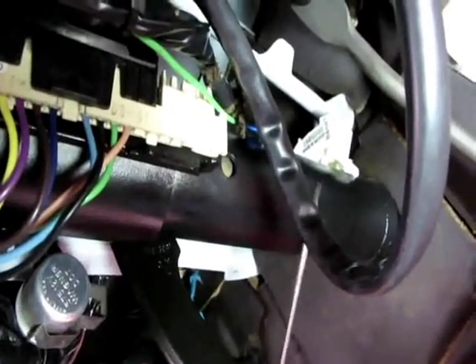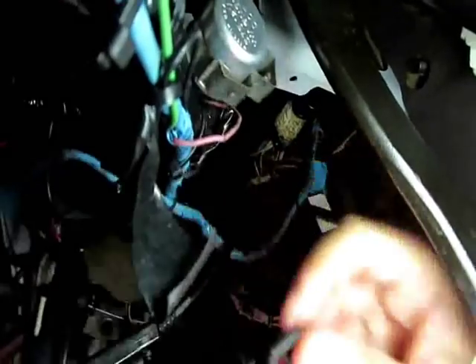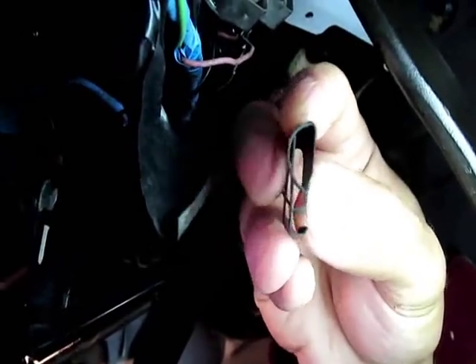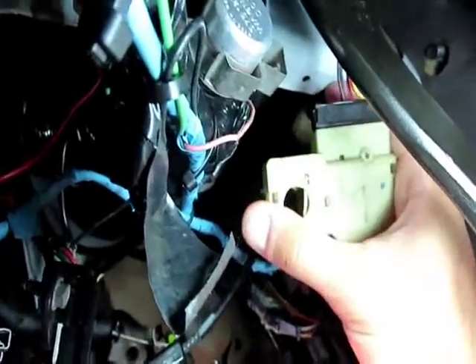The clip does rotate around so you can position it in a better location. It's about 102 degrees outside, so don't try to do this in that heat. This is a '94 — the dash on this year is a bit different but the column comes out pretty easy, just two bolts and it'll drop down for better access. We went for it anyway and got this one off pretty easy. You see that tab you have to lift — put a pick tool in that little crevice and keep prying. Got it out. Now pick up on the switch, slide it off, and always do the electrical connection last.